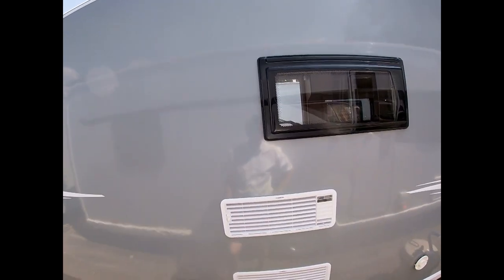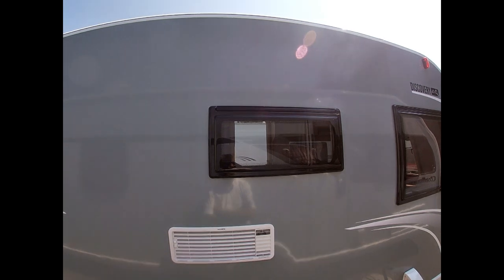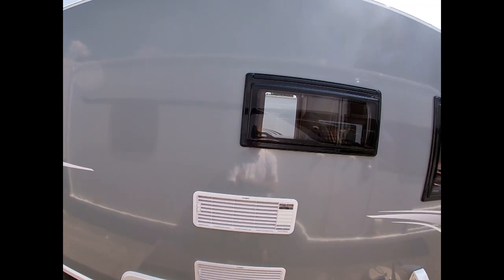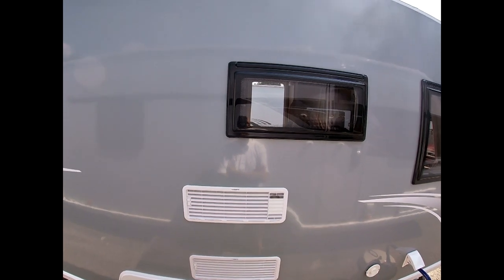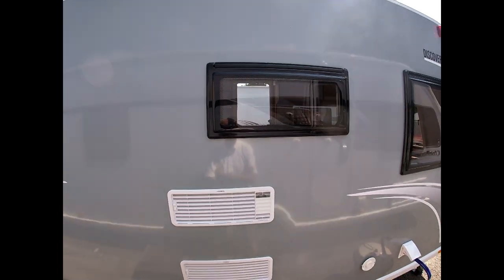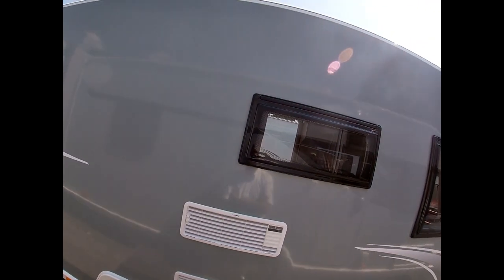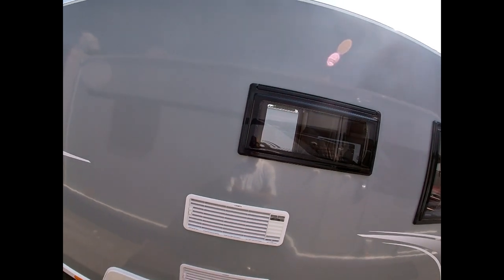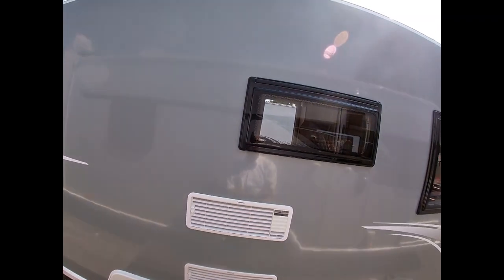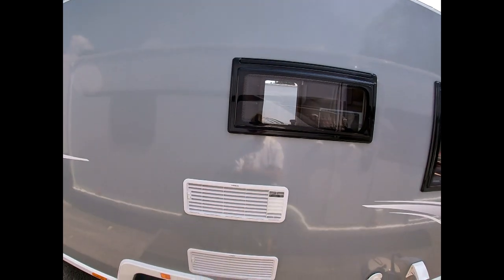The other reason we need to be level is for our fridge. We briefly touched on that earlier: the fridge in this caravan might look domesticated when we get inside, but the reality is the fridge in here works completely differently. It's a three-way fridge. It's got three separate heating mediums, and those heat liquid ammonia, in actual fact, which changes state to a gas. It's the gas that becomes the cooling agent, cools down the fridge, and then comes back as a liquid and reheats again. So I can operate my fridge in any eventuality.